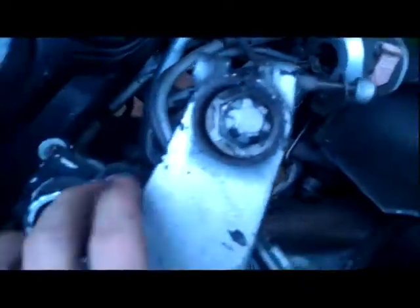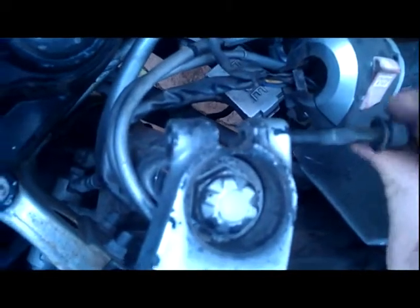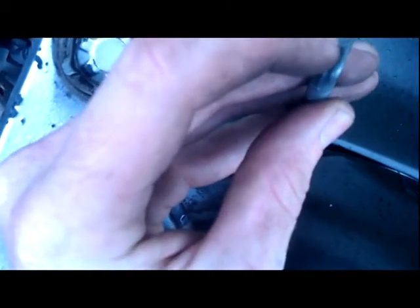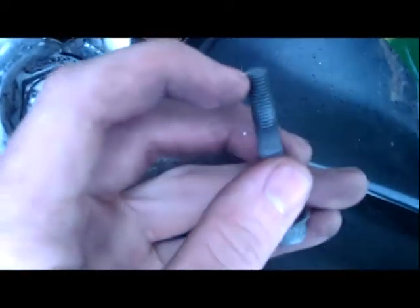Now it's off. I'll actually show you that I can thread this bolt out by hand — unscrewing it by hand and it's moving perfectly fine. Threads were not damaged. If you do this wrong, threads will be damaged, so watch carefully how the wrench is pushing against the bolt. You can see where it was moving against the wrench on the end, shining it up a little bit, but the threads are undamaged because it wasn't over-tightened. So there you go — undamaged bolt, undamaged aluminum. Thanks for watching and subscribe.